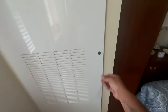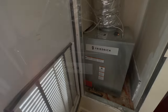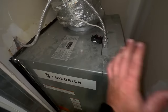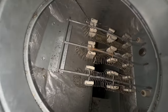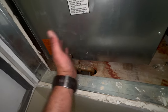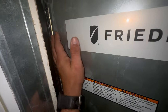This one has a little lock you have to undo with an allen wrench. There's no actual access door you can remove on these. This is your electrical panel — we can take that off, but all your motors and components are underneath right here. There are screws going around and also on top, so we'll probably have to pull this out to get all our screws out. We'll also be removing this duct. We're going to have to try to remove this whole top. Luckily it has a union here for the copper drain, so we'll disconnect that to move things more freely.